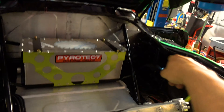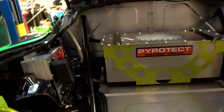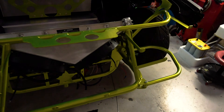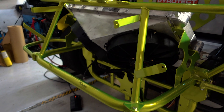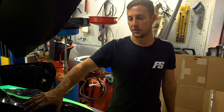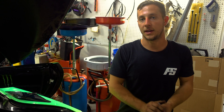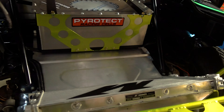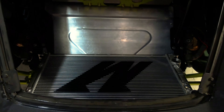We're just wrapping up the tail end of Juwan's radiator mount, fuel cell cradle, and fuel cell. Chris has all of his wires tied in the back, nice and tucked away — everything's sealed, the firewall is sealed. The only things we have left to do are put the lights on tomorrow and wire the fans. Once we get the rest of the fuel cell stuff — the Nuke Performance drop-in internal fuel surge tank — we can figure out all the positions and where we're routing our hoses. The last little bit is building some shrouding so that airflow from the back window gets directed at our fans.